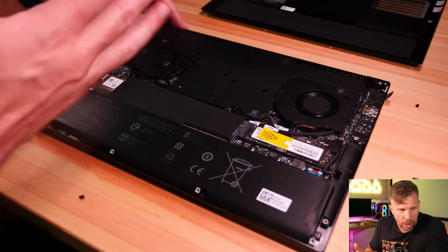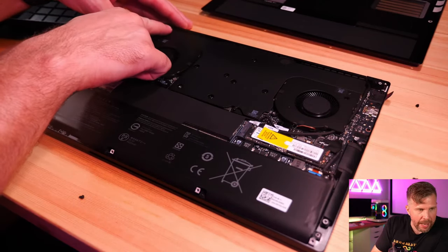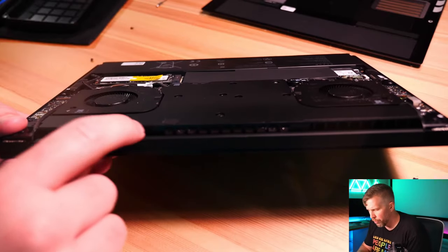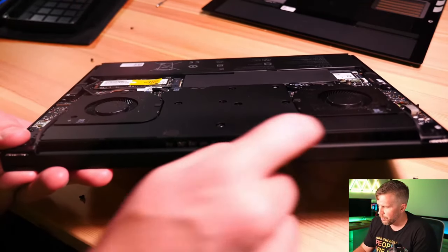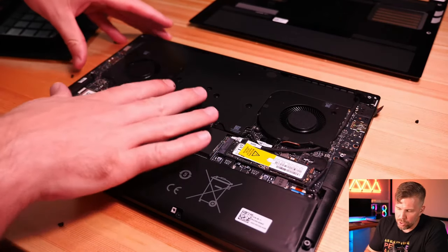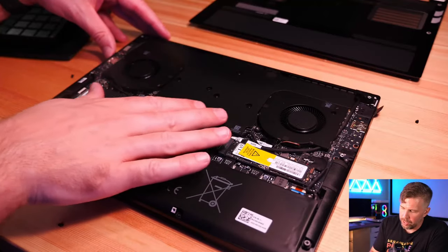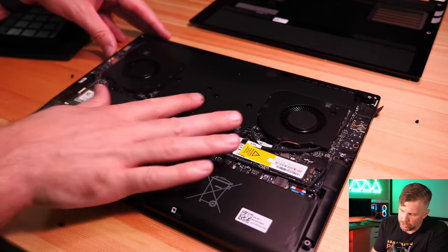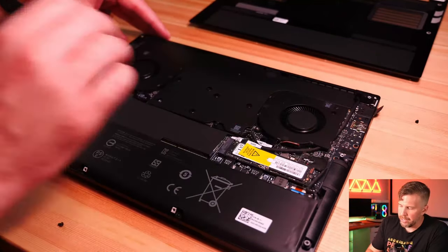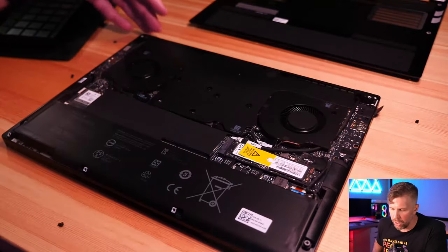Vapor chamber cooling here, the hot thermals are gonna warm up right here in the middle. The vapor is gonna travel out here to the fan outtakes right here and right here. They don't appear to do much because all of the heat fins are on right here to right here. These are the heat fins, but this middle section doesn't really have anything. A vapor chamber can basically use the full amount of cooling for either the GPU or the CPU completely. If it's just the CPU or just the GPU running, then it'll go right to the exhaust either way. And in addition, the nice thing about vapor chamber is it can also cover the VRMs and keep everything cool on the motherboard. You just get a lot more coverage.